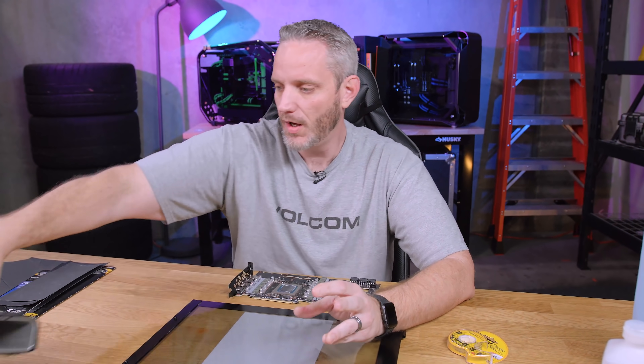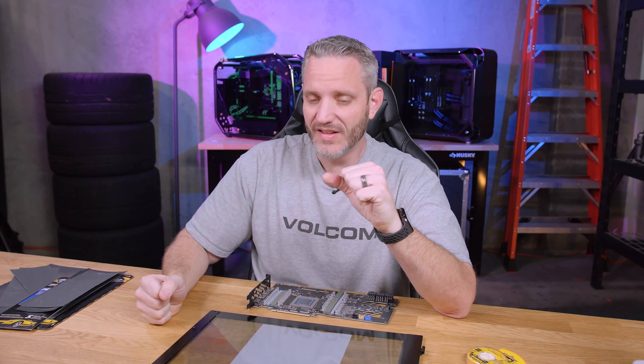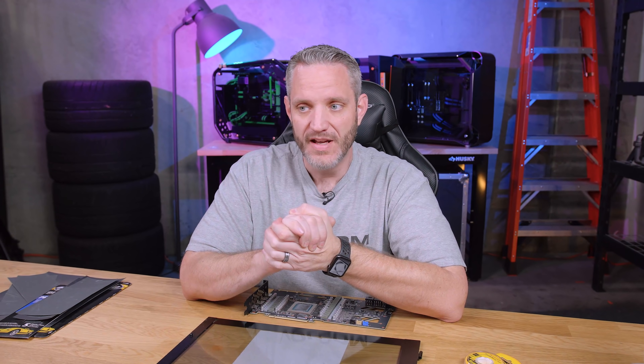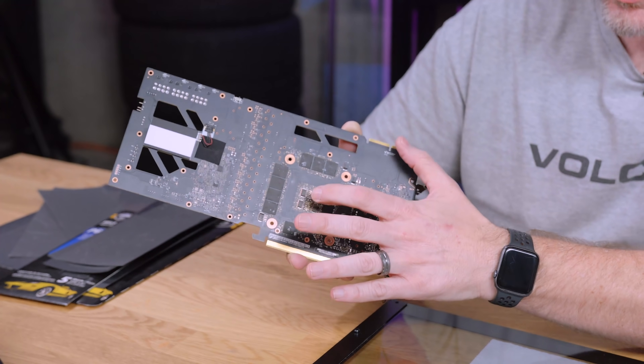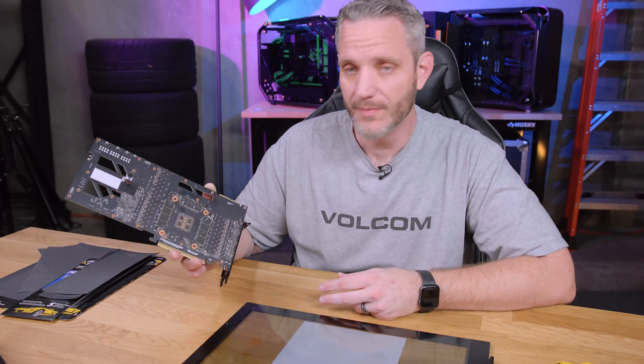These raised letters are possibly causing me a problem of not getting good mount all the way to the edge. I'll get like a circle and then the edges all have thicker grease on them, causing bad mount problems and keeping me from going any farther — it starts to get hotspots on the die and then it crashes. I basically took that C-clamp and put my weight on it pushing hard against this copper pot to try and get a good mount. Nick couldn't believe the card was surviving.